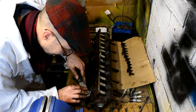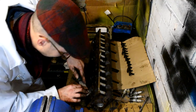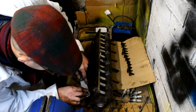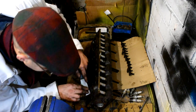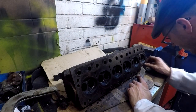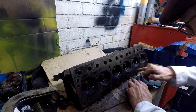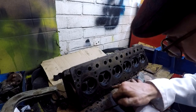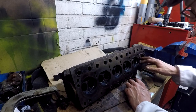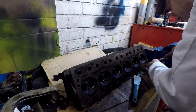And same inside here, where the valves sit and the compression and all the magic happens. Just got to be very careful how we take that crud off, and it seems to be coming up quite well. And I'll do the same inside these little water jackets here and all the oil jackets. Just clean them out best I can with an old screwdriver, just getting rid of all the crud,